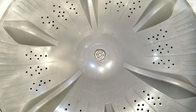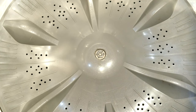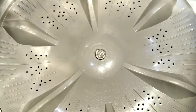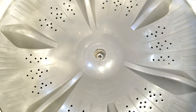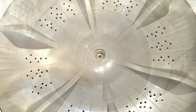Just having a look at that nut there, you can use a flat screwdriver like that and turn it — I've pre-loosened it — or you can use a socket. This is an impact wrench and you can unscrew it. You might find that it's very tight. Removing this is often quite difficult because it's been sitting there probably for years and has fastened itself pretty tightly.